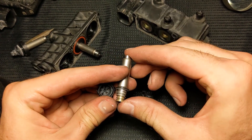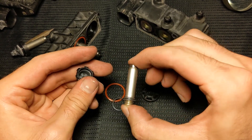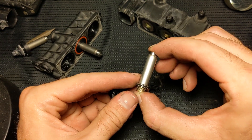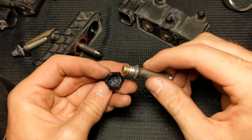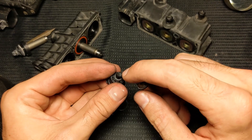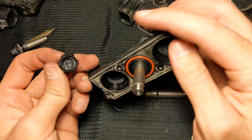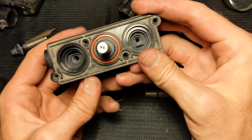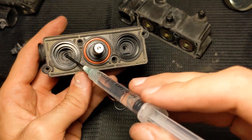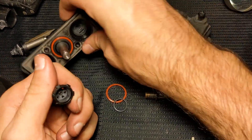This is the solenoid. When the electromagnet becomes energized it pulls this in — this is off, and then this is on with it pulled in. A solenoid can easily achieve this amount of pull. There's a little rubber gasket, and when it opens it opens up the channel that communicates from the inside — the very deepest hole — to the periphery. When it opens it connects the two channels; when it's closed these two channels are independent.